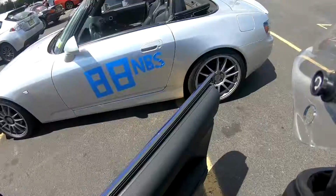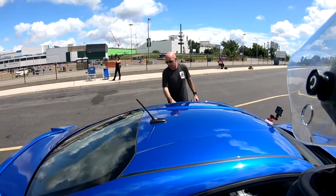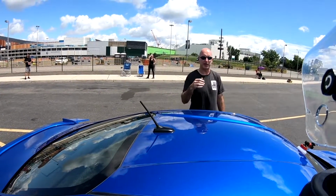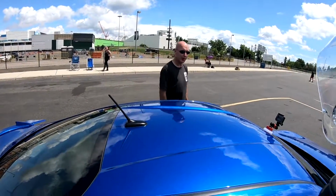Stiffen everything. That'll probably free up the back too from how you're doing it. Either that or maybe what you want to do is jack up the rear tire pressures to try and make the back a little looser from that standpoint. Try and take away grip out of the back. Okay. All right? Cool, thank you so much, GJ. You're welcome.